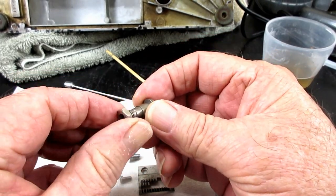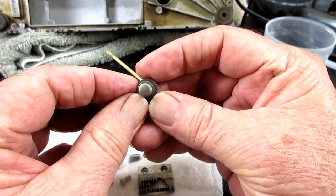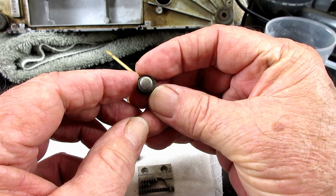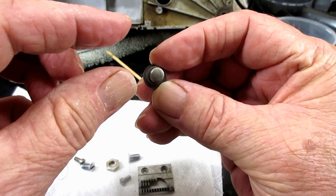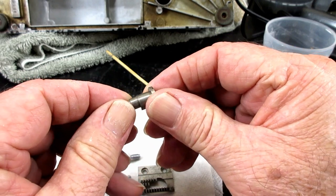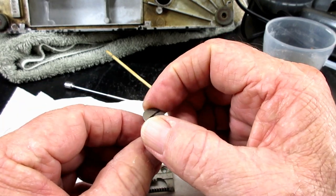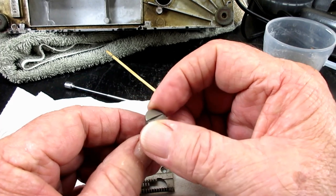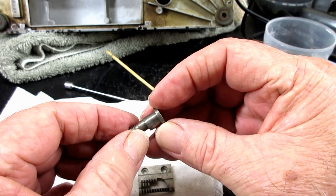You can see that it's off center here. Let me take this off now. You can see that it's off center, the hinge. The head and the screw are lined up like a normal screw, but you'll see that the hinge part is not. It's off center. It's kind of pushed over this way on this side. And that's what makes it eccentric. Cam stacks are that way too. That's why you have to adjust that eccentric post on a cam stack to bring the cam stack gear closer to the worm gear of an arm shaft. So I just thought you might care to see that.